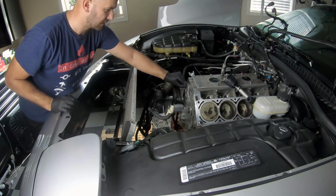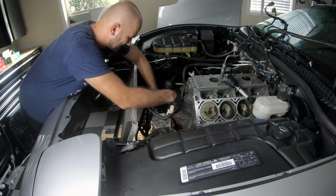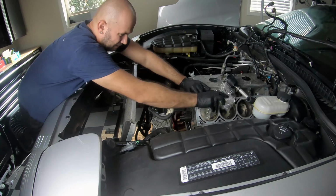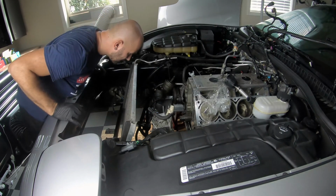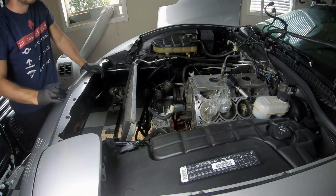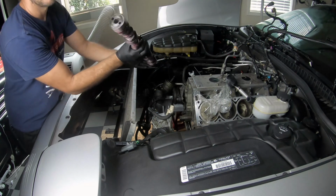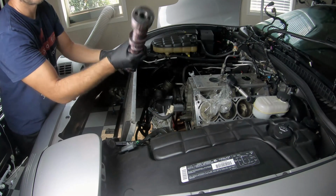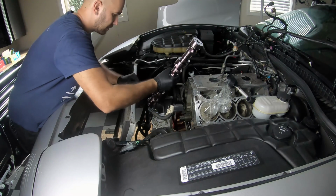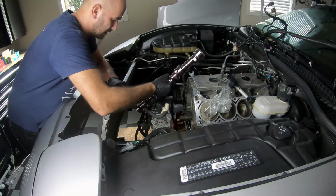It's finally time to start taking off some of this stuff that I had taped on here before. Get it all removed. Yeah, for now. Cleaned everything previously, so everything looks pretty good. So now let's just get the cam. Alright, cam ready to go in. As you can see, on one side there's 2 holes and the other one there are 3 holes without a pin. Obviously the one with the 3 holes goes in here. So right now we're just going to move this.